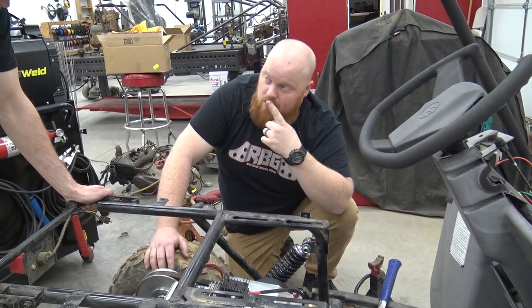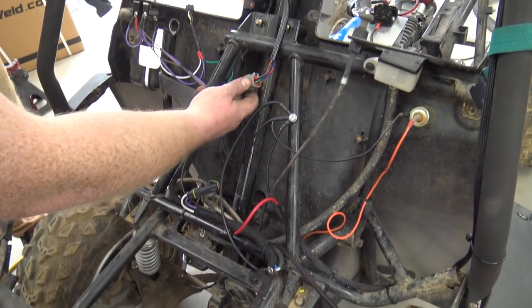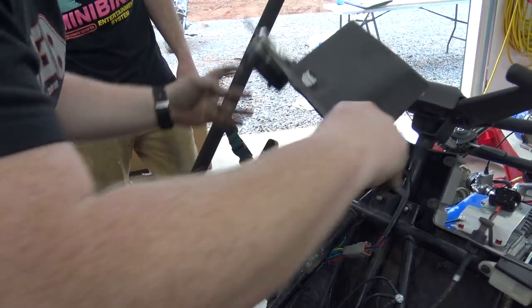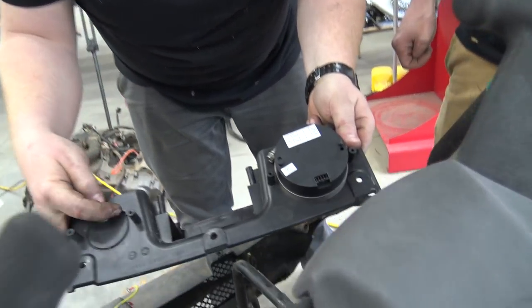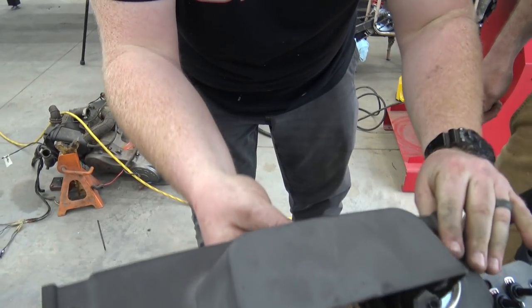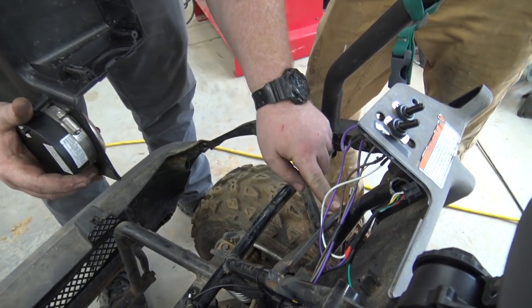We're really close. Next we go to the exhaust. The whole wiring on this thing is done — we ended up using the Eton Rover's factory ignition, which is pretty sweet. We put on all kinds of super nice waterproof connectors. We have a tach input here, and this factory dash clam-shells like this. It had a factory spot for a tach and this cutout will be perfect for a voltage gauge, which we'll be installing later. I had to cut this section of the frame out to fit the tach because the back of it was hitting right there, and we added a support down here.